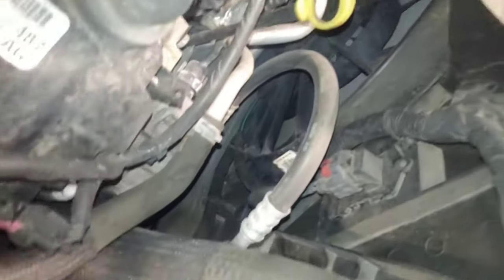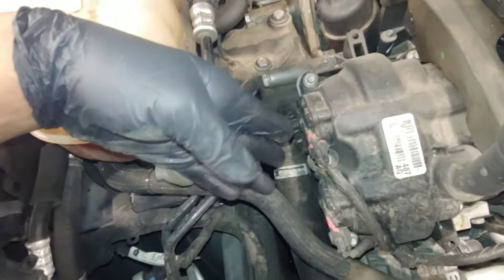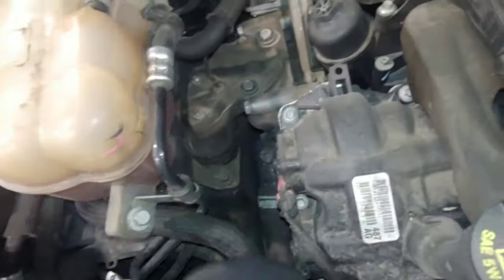What you can do is drain the coolant. Usually 9 times out of 10 the radiator has a drain plug, but that will completely empty the system. All I'm going to do here is undo the hose, and that way the system will just partially drain and not completely drain. So let me get some pliers and get this hose off of here.